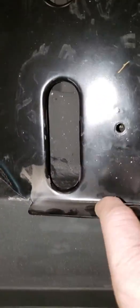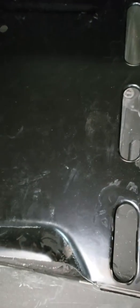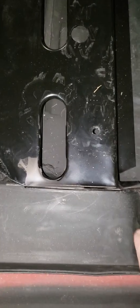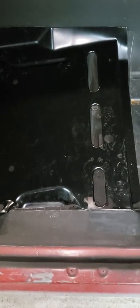I had to bend these tabs over — once I get this set down in the floor firm, I have to bend these over and I'm going to weld them across here, and the same back here. It's just part of the thing of modifying. I know it's not exactly right, but my main thing is I don't want to get these distorted because I want my seat to sit flush, and I also don't want the seat crooked or tilted too far back or too far forward.